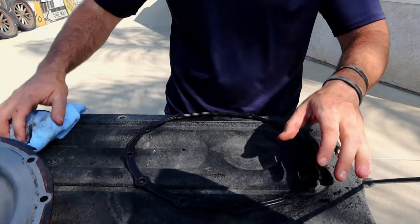One tool that you might need that I forgot to mention is a torque wrench. They say 30 foot-pounds of torque for these bolts. I happen to carry this because we run an Anderson Hitch and you can pull it out of the bed with three bolts extremely quickly, so I carry this under the back seat of the Ram. 30 foot-pounds is not very much at all, so just don't over-tighten them — just pretty much firm is what 30 foot-pounds of torque is. Remember, same thing — we're kind of hopping around side-to-side in a cross-pattern. Everything is torqued down to spec. If you don't have a torque wrench, you can do it the German spec, which is just good and tight. As long as they're firm you should be good — just don't over-do it.